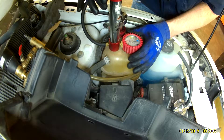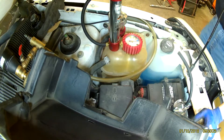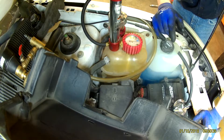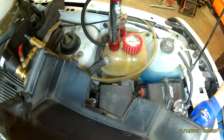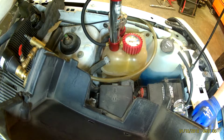Now I'm going to put the front of the car back together and just let it sit. I do have one small leak in one of my heater hoses where I had to take it off to do the intake, which is normal. It's very minor — once that hose heats up and cools down once or twice it should seat on there. It's just a matter of getting the hose soft so it can form to the fitting. While that sits there with pressure on it, I'll bring it back to the front and you can watch me finish assembling the vehicle.